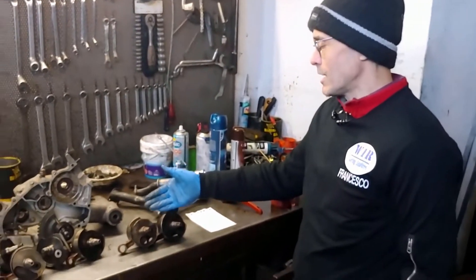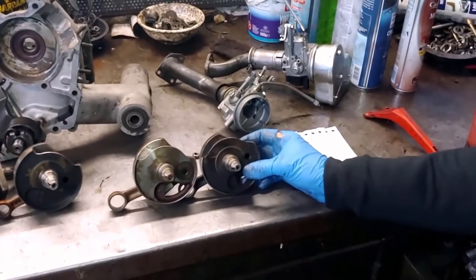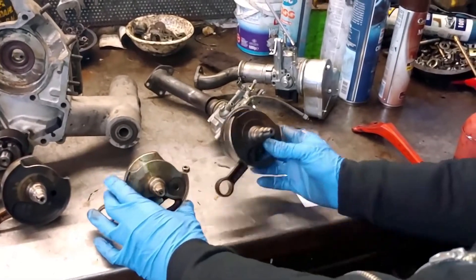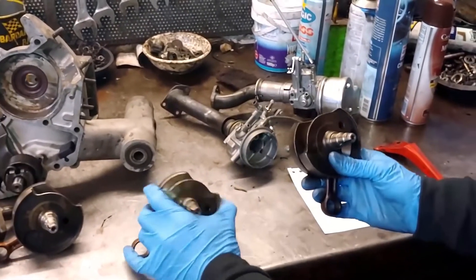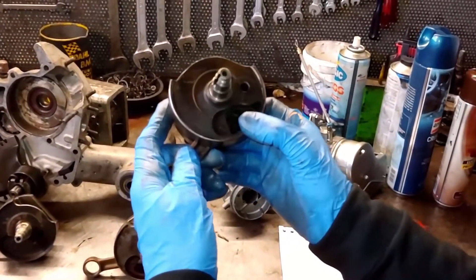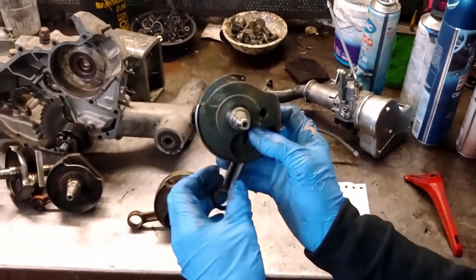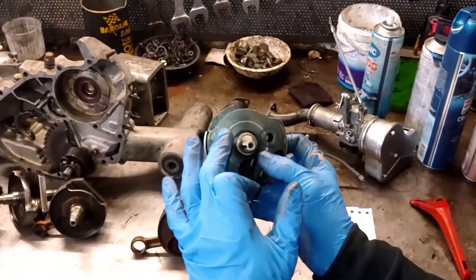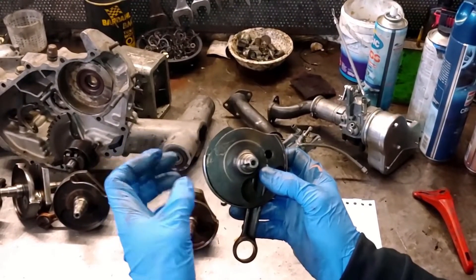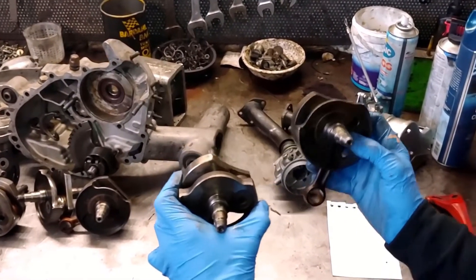Now let's go back to today's topic and close with some considerations about the evolution of the small 125 engines — Piaggio long stroke, original in this case. Here are the two shafts: this is Primavera ET3 and this is ETS. The shaft of the ET3 differs from that of the two-port Primavera because it has a considerable advance and an extra intake opening. The Primavera has a more closed phase — I don't have a Primavera shaft to show now, but the phase is much tighter. The ETS and ET3 have essentially the same intake phase — it really changes very little between them.